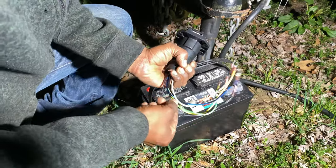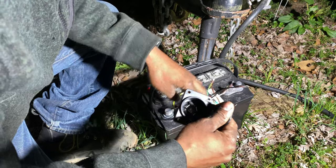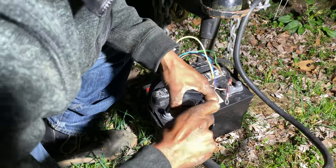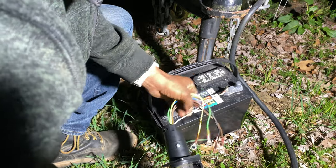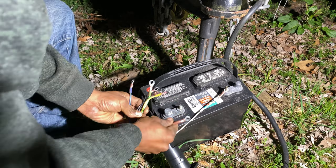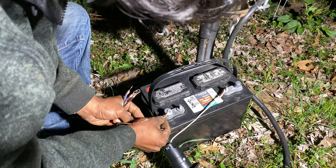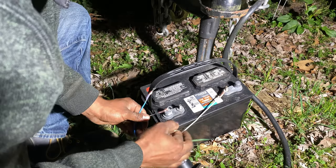Now that we've got our seven pin tester built, let's go try it out on a trailer in the yard. Just like our test setup in the studio, I'll grab my white wire and attach it to the negative terminal of our battery. I'll then open up my socket and put in my connector from the trailer. Now we've got our trailer hooked up — taking the brown wire for running lights and hooking them up first. Look at that, we've got power! Next I'll take my yellow wire and pulse it — this should give me a left turn signal, which it does. Going ahead with the green wire for the right side and pulsing that wire.